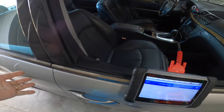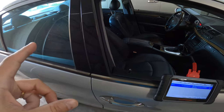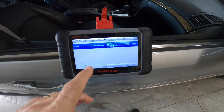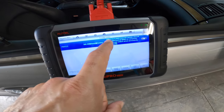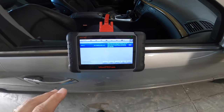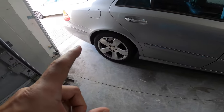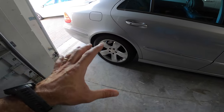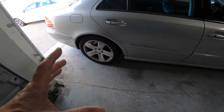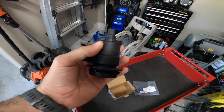I did recently replace one of the sending units — it's actually the fuel pump. I don't know why it's called a sending unit; if you know, let me know in the comments. But once I replaced that, the leak went away and I tested the tank — there are no leaks. I'm suspecting it's going to be the activated charcoal canister shut-off valve, and I've already done some digging — I took the wheel out. This valve is located on the passenger rear wheel behind the wheel well.